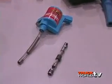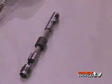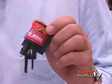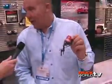It gives you more energy, no EMI or RFI interference, better power and better economy. To complement that, we have what's called the Granatelli Pro Series coil. The standard coil is typically 20,000 volts; ours is 60,000 volts. So we get you three times as much energy per engine revolution, which equates to better mileage but, most importantly, more power.